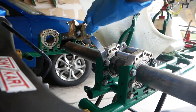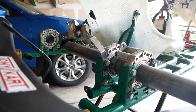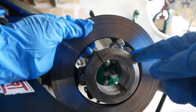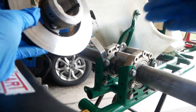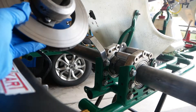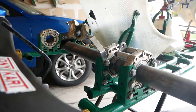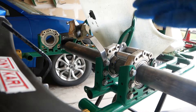Before you go all the way in, you want to put your brake carrier — this piece right here — and also your rear sprocket. If you don't have a split one, you'd put it in there so you don't have to pull it back out and redo this again.